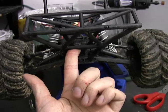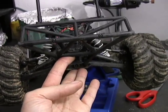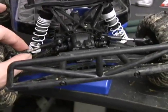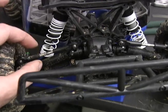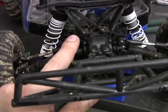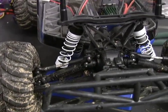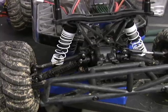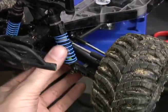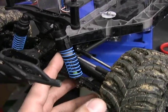And then I set the hubs down to their lower position to give myself a little bit more center clearance, and also reduced the length of the rear camber links, and mounted the inner one to the lower point, which gives me more camber gain when the truck leans. Up front, I'm just using these more traditional low-C springs, the 2-inch, 3.8 pound per inch